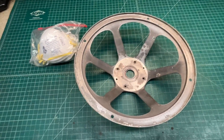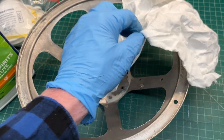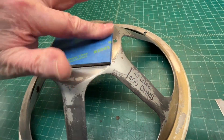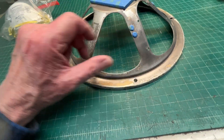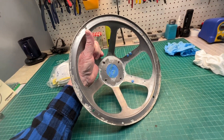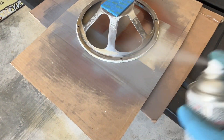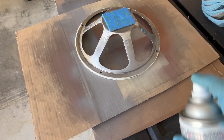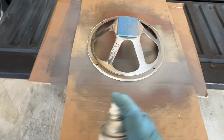I'm going to take this outside now and give it a nice wipe down with some mineral spirits, then get ready to prime and paint. Just taping out that top plate. You can see a little additional tape around the areas that are isolated for the output transformer, humbucking coil, and voice coil connections. And flipping it over, you can see around that center pole piece as well, and of course on the inside of the basket where the lead wires will attach. Just a few light misty coats around the perimeter of the loudspeaker, and I'll come back and apply some additional coats within a minute or two.